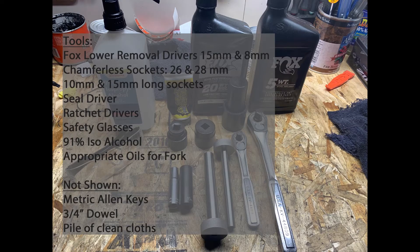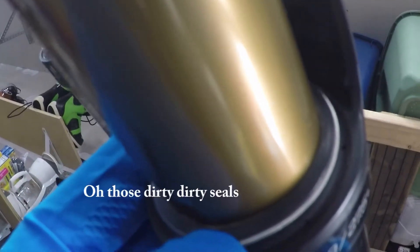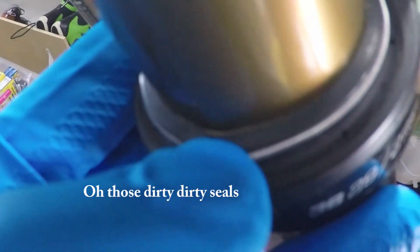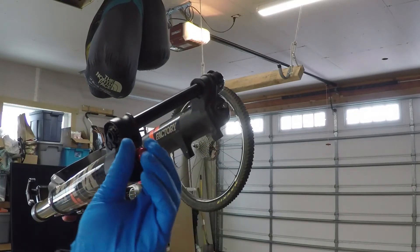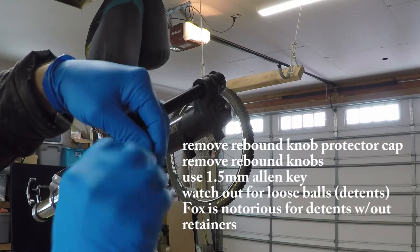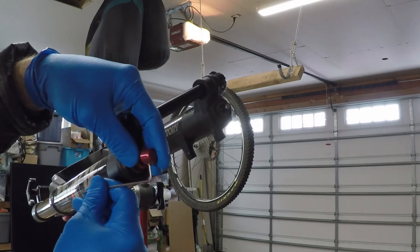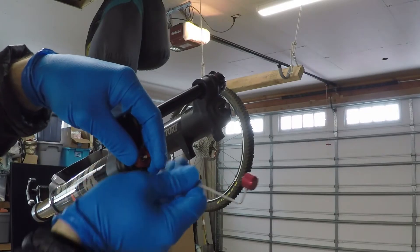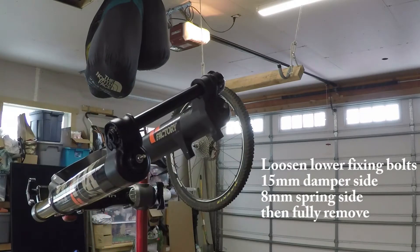Pause right here and read over the tools that you need — several tools plus a couple additional ones you'll see me use in the video, like o-ring clips and things like that. Make sure you have safety glasses. There's dirt in those seals — you need to change those seals. Remove the rebound protective cap and then remove the rebound knobs off the lower part of the fork using a 1.5 millimeter Allen key. Make sure there are no loose detent balls — Fox is notorious for this — so remove slowly and cup your hands to catch anything that might fall out.